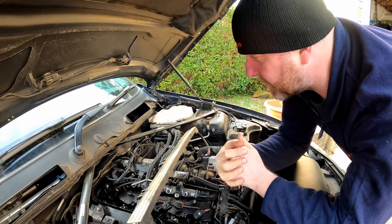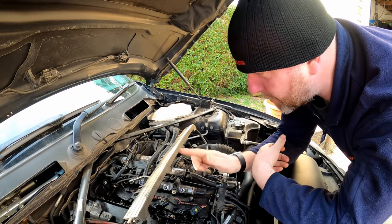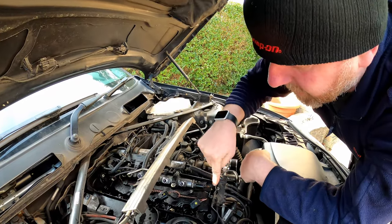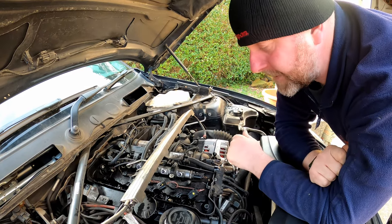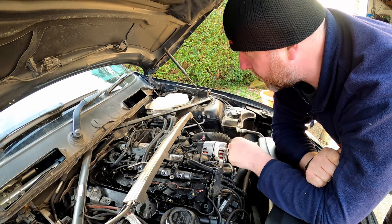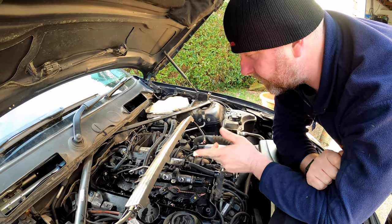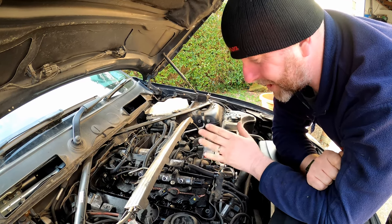And I probably should have thought about this before, to be perfectly honest. What I'm going to do is I'm going to remove the cam cover and replace the gaskets. Now, there's one gasket that goes all the way around the outside of the cam cover, and there's another gasket on each of the ports for the injectors. So I'll go and get those as well. I'll leave the part numbers and any links for anything that I get for this in the description so that you can go and have a look. But obviously, I'm not going to have them right now.